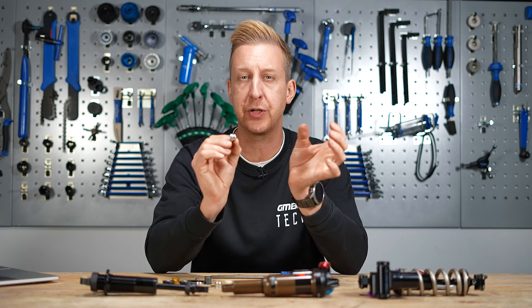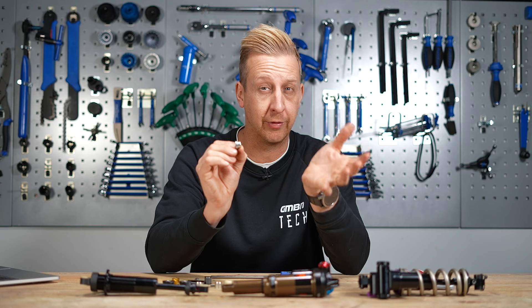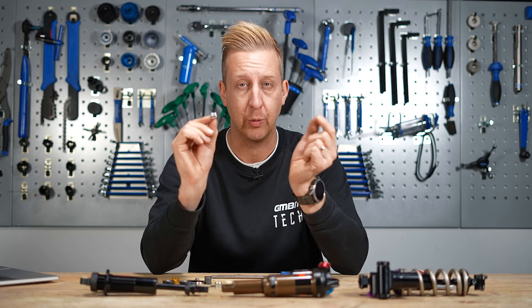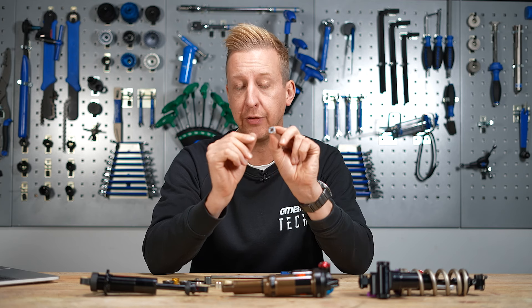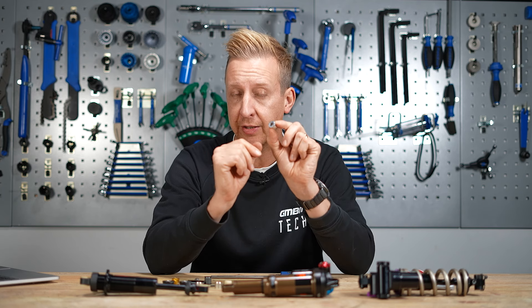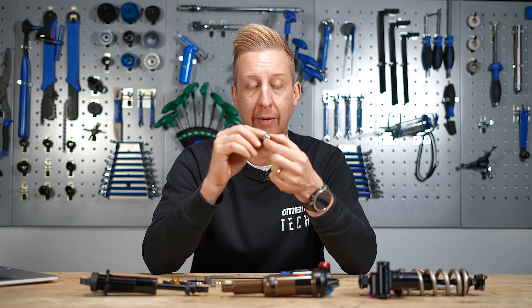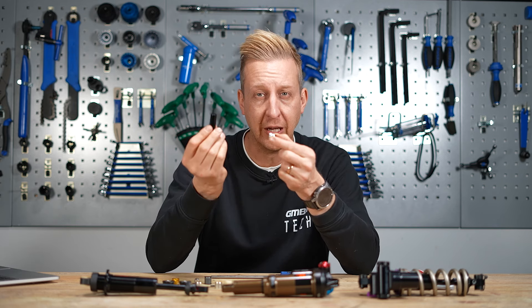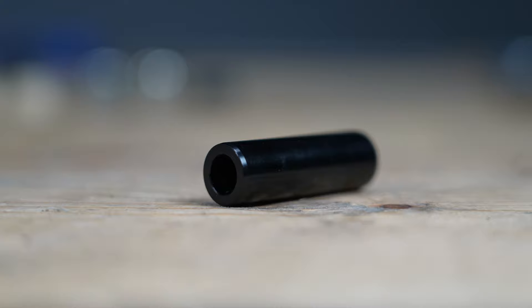The one other unit you might see is a standard-duty. On most shocks these days you tend to see heavy-duty. The standard-duty will have the bushing in the actual shock — whether poly or DU — and you have little aluminum top hats which push in and the bolt passes through these. These are great and you can fit them by hand, but the downside is they do wear out fairly easily. The heavier-duty option, although harder to fit, lasts much longer and makes more sense.